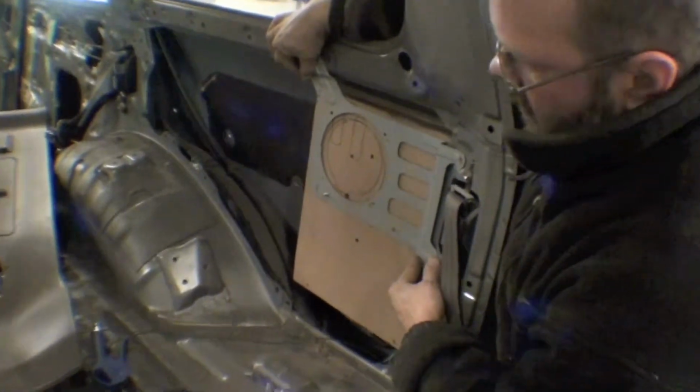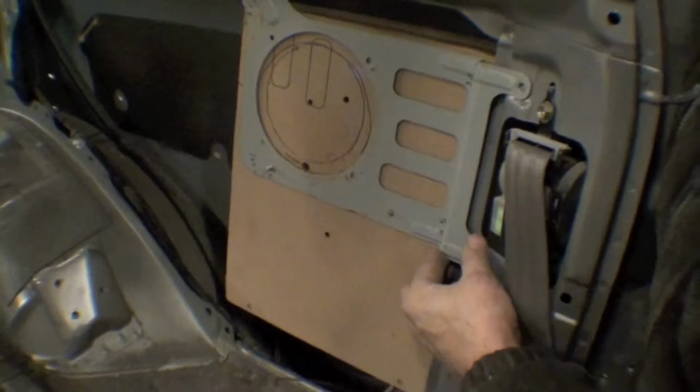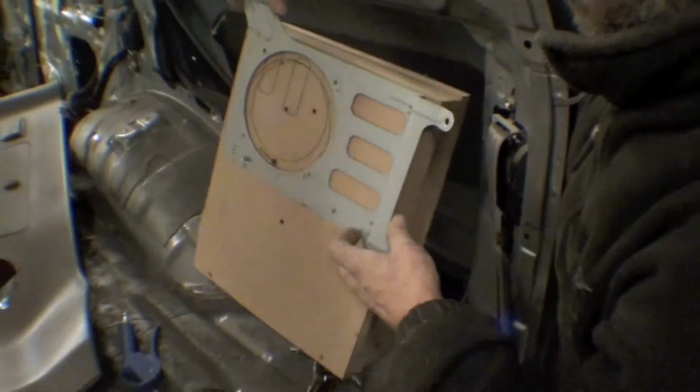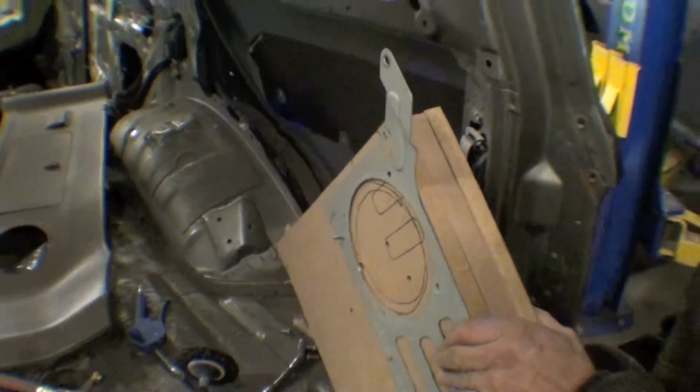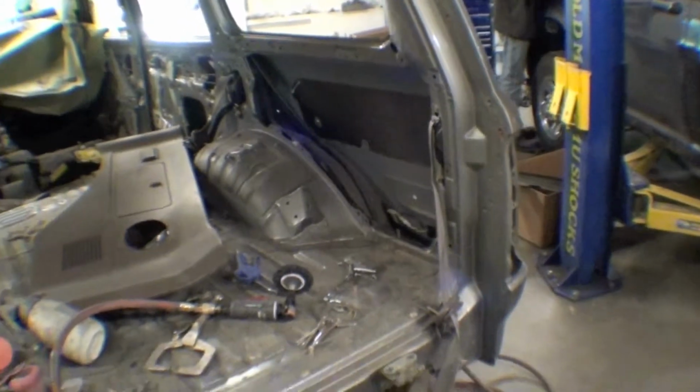We've done several of these. You can see the bracket that we're using. And it'll sit right in there. And it's substantial because it is heavy, but this is important that this is about 1 inch. Yeah, three quarter inch. 3/4 inch. So that'll allow us to install this right back here. It'll have good breathability for a sub back there on the quarter panel.